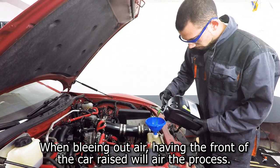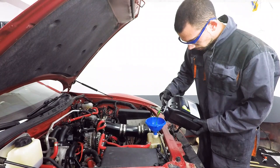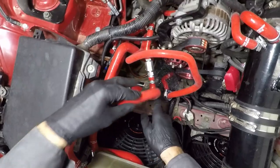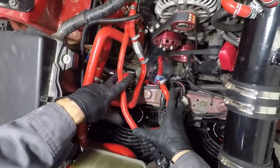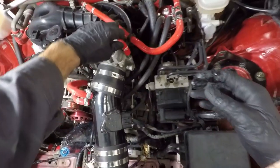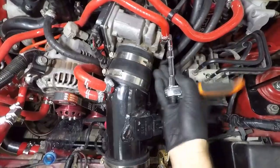Next up, start pouring in coolant. If when pouring the bottle doesn't suck any more coolant and it still hasn't come out of the bottle, gently bend the throttle body hose so that it gets as low as possible and then you'll start seeing coolant coming out. Once you have a steady stream, take out the hose and put it back on the throttle body and then tighten it.